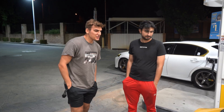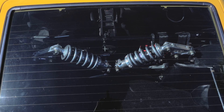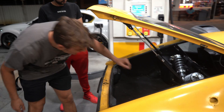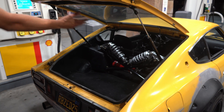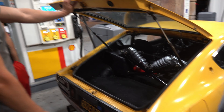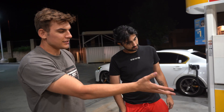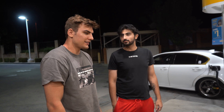So what made you want to go with the coilover suspension? It just looks sick, honestly. You really can't deny how awesome that looks. I mean, there are a lot of advantages — I can open this up and change my shocks like this, it's extremely serviceable. I can take the shocks out whenever I want, adjust the ride height really easily. There's less unsprung mass for the rear wheels, though it does bring the center of gravity up a little bit because all the weight is higher.